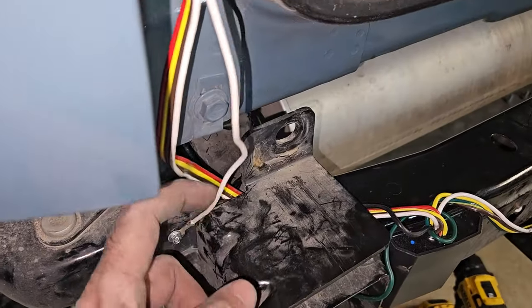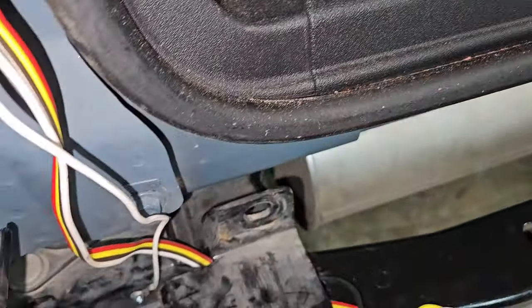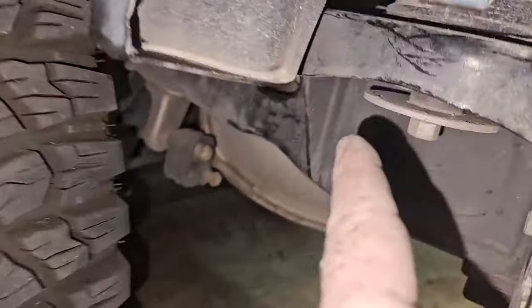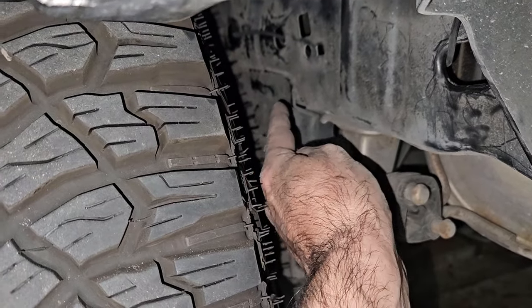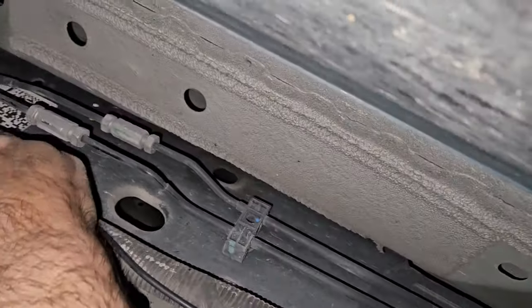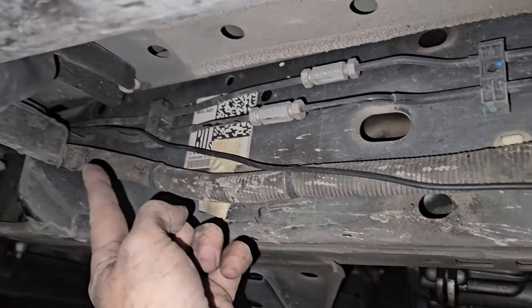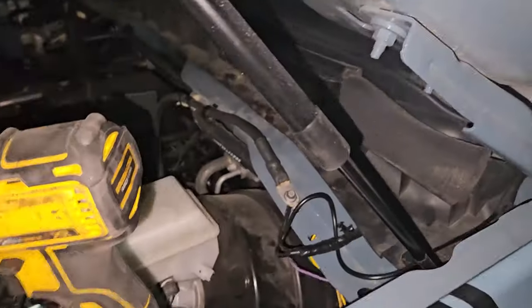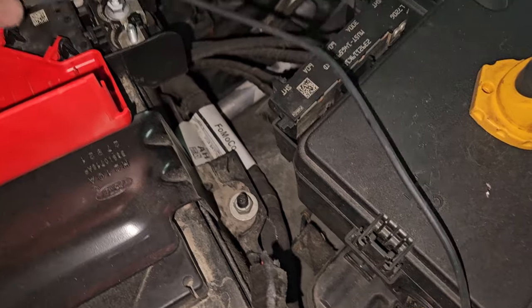Ground is here. For the positive, I crimped it and stuffed it back here — I ran the wire through here, through there, out through here, and then back in through the frame to the back. I found where the brake line is and it crosses over, so I made it cross over the same way, then all the way up. I could put a zip tie here but it probably doesn't need it, then up that side and right up through here, straight behind all this, and it's going to plug in here.